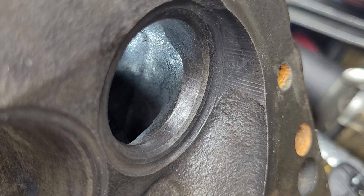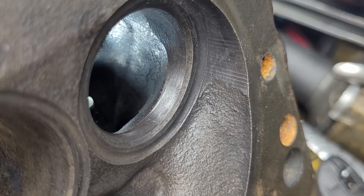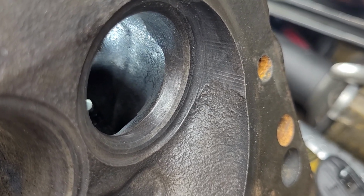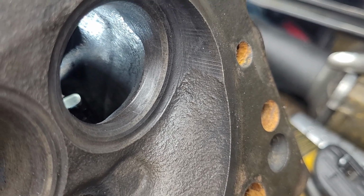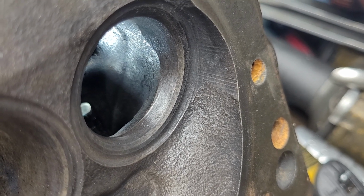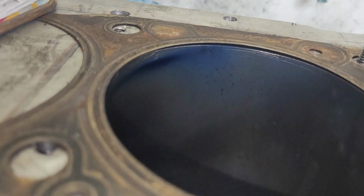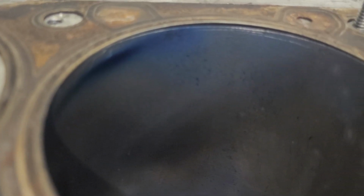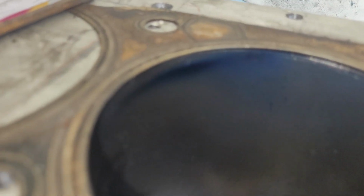Okay, the exhaust has got a razor sharp short side radius. I'm willing to bet we could do a little better on that. You can see at least 3 distinct angles on that, so that looks pretty good. Interesting splatter on the completely stock, with just a valve job, 318.